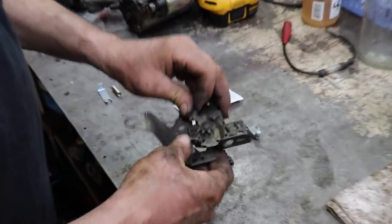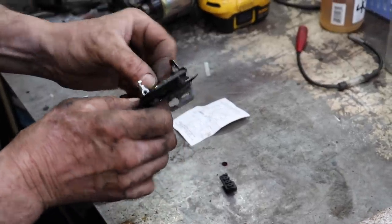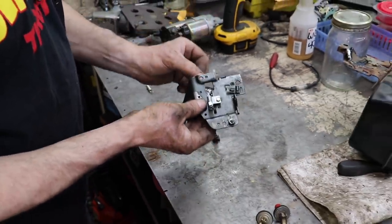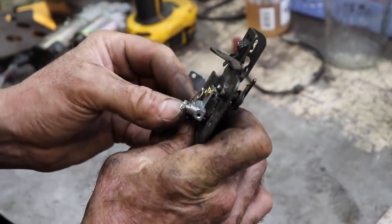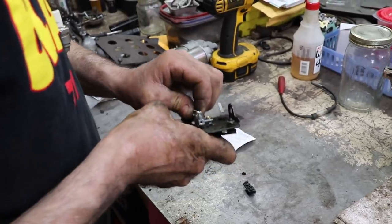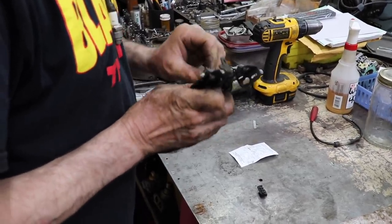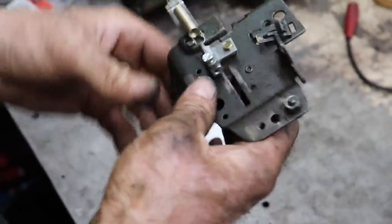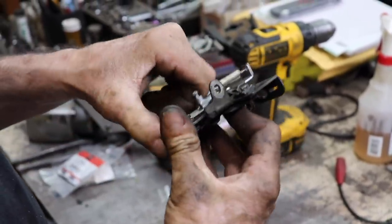Let's take this one off and put this one on. Tighten that up, and then this fits in these holes like this, and this is your spring — so I won't need that big spring they had hooked up. I slide my stranded cable through there and tighten that down, and then when we step on the gas pedal it's going to pull this across.